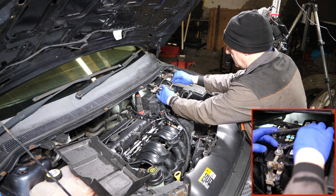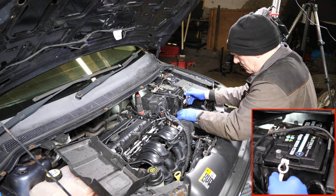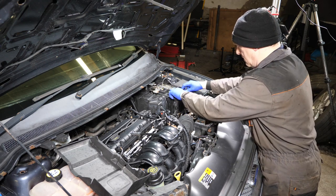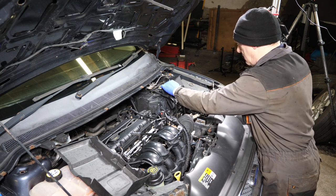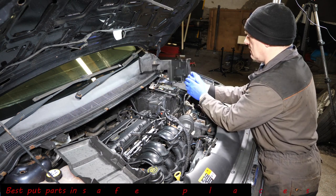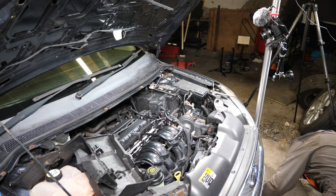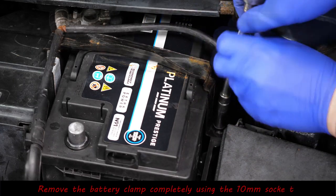Now we can safely disconnect the positive. It might be worth putting a plastic cap on the negative terminal just to make sure it doesn't jump back and short out — I actually found that happened, the wire pushed it back. Now there's a little cover here to remove which unclips, but you do need to remove the wires off that cover. Watch as I knock the rubber retaining ring on the floor — the plastic cover catches it and throws it into the engine bay.